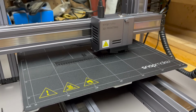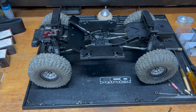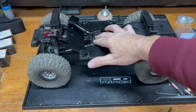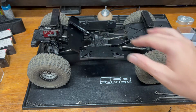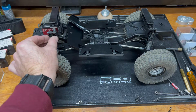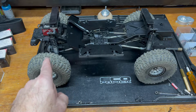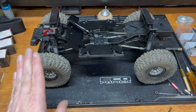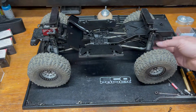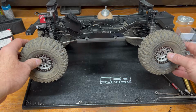But anyway, I'm gonna get back to links. Wheels on tells us many things. I think the final ride height will probably sit right around there. Should be quite good. But now with wheels on it, I can really tell. Rear lowers good. Front lowers too short. Front upper seems okay. Rear uppers actually not too bad, because of the pinion angle, it's a little steep.